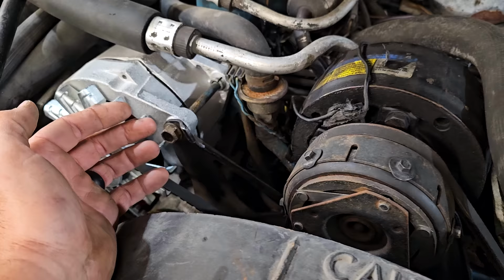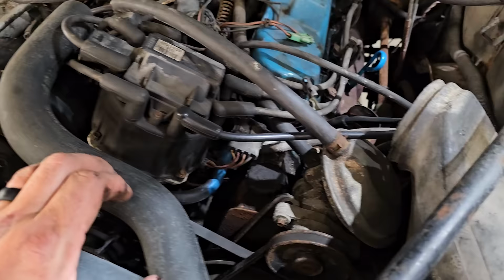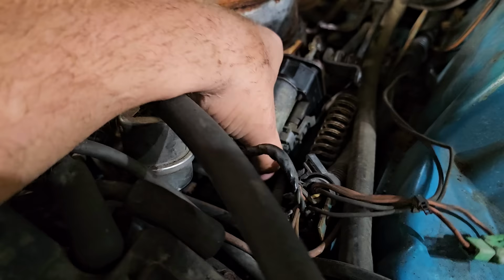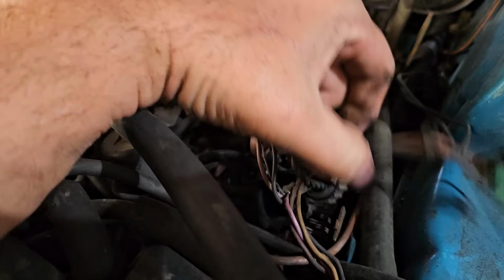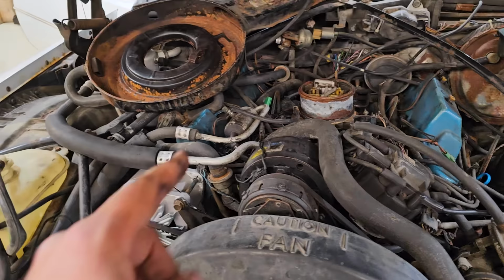Okay, coolant temp sensor. Okay, that's this guy. Okay, that's unplugged. That's my bad. We'll get that figured out. This is the spark control. That is also unplugged. Okay, we're doing good. Doing good so far. This is the idle motor. This is what would do the high speed idle. That is plugged in, with some really good connectors. And the barometric widget box is under the dash. So let me plug these two things in, see if that does something.